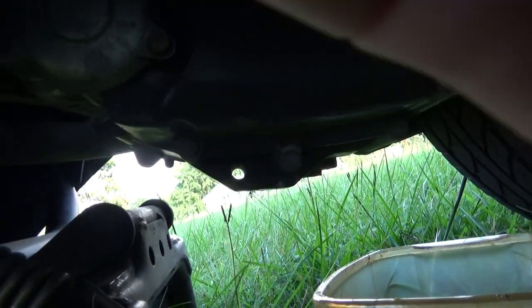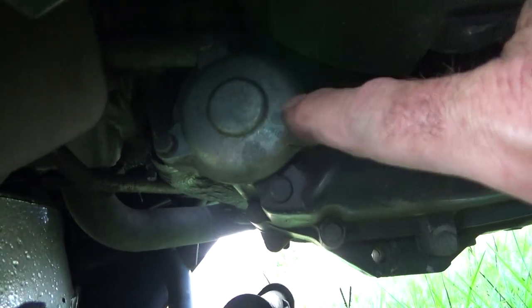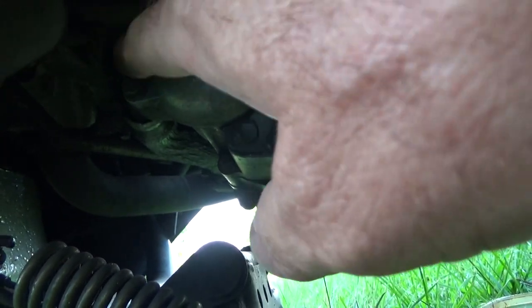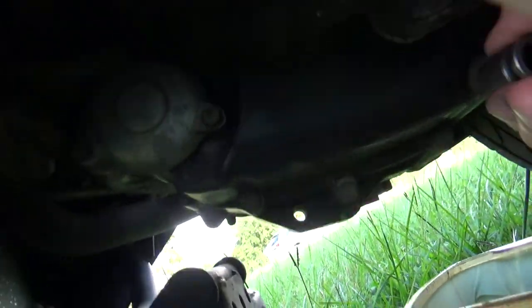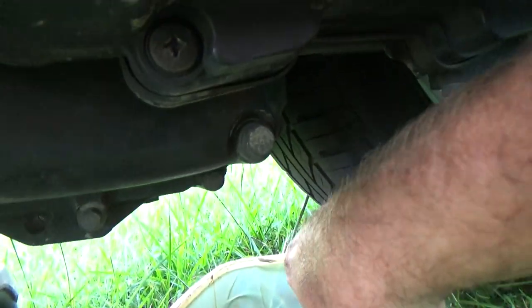As you can see, this is the oil drain bolt. This is not the original bolt — the original bolt was all chewed up. Got one on eBay a while back. It's a little dirty under here but this is a magnetic drain bolt. Any loose metallic particles will make their way towards that, keeping them out of important moving parts. Nice six-sided now — use the six-sided socket on it and you won't have any problems.